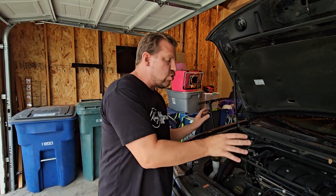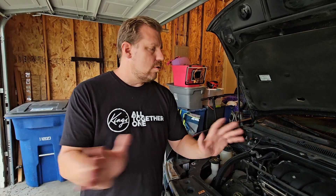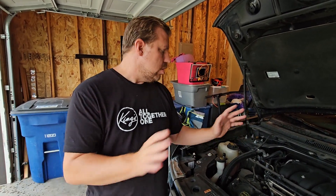Not many people do a coolant flush, and when the water pump goes at 120,000 or 130,000 miles, it's because coolant was never flushed. Put in fresh coolant right around 60,000 to 80,000 miles. So if you own one of these cars or are thinking about buying one, talk to the dealer — ask if a coolant flush has been done. If they say they don't do that, move on. Make sure a coolant flush is done, especially given the miles on it. That's number one preventive maintenance.